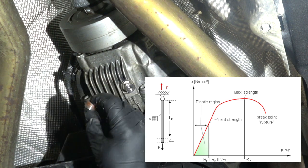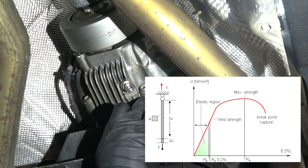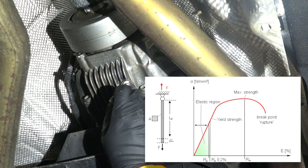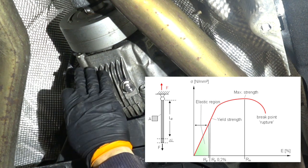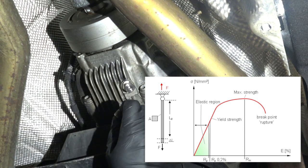Because this is a tapered steel plug against a female aluminum drain threaded hole, torque applied is perfunctory, which means that trying to get to specified torque is either not quite perceptible or difficult to achieve, and will inevitably make the drain hole weaker as it exceeds the elastic characteristic of the material and travels to and through the plastic deformation zone until it fractures.